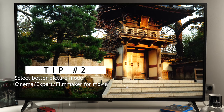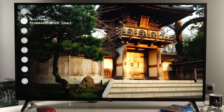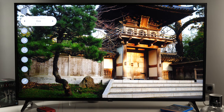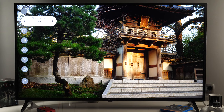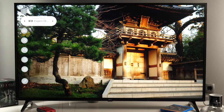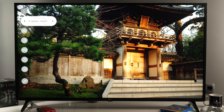The second tip is to use the best performing picture preset by default. This TV has several picture presets. Press the settings button on the remote and scroll down to picture mode, where you can toggle between different modes. For SDR content, the TV will come in eco mode, which is far from accurate in terms of white balance and colors. For SDR — watching movies, live TV, and TV shows — I recommend cinema mode, filmmaker mode, expert bright space, or expert dark space. These four accurate picture presets can be adjusted to suit your needs and your environment.